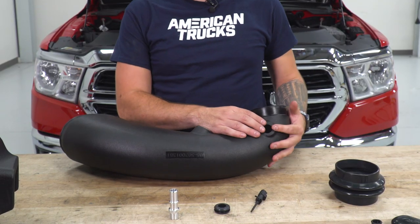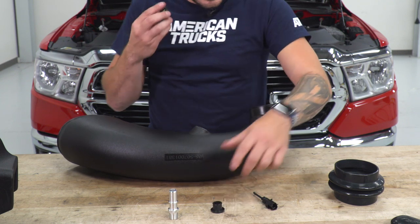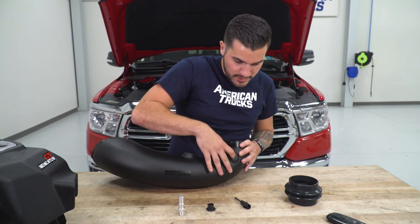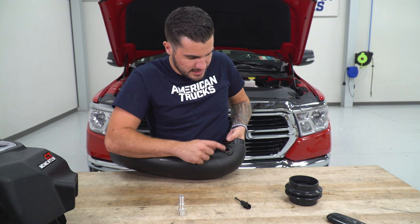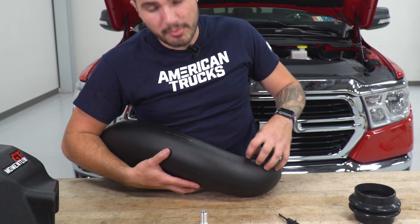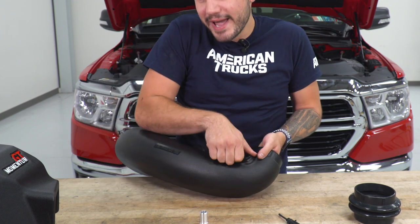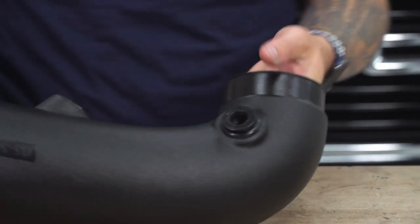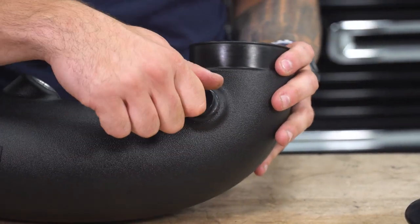Let's focus on the tubing. On the side, you'll see a pre-drilled hole where your sensor will seat. You'll need the adapter and grommet included in the kit — the grommet ensures no air leaks, so set it all the way around that hole, then push the adapter into place. Keep your fingers on the inside to keep the grommet from falling through — you want it to stay seating flush. If it falls through at all, there's gonna be an air leak which may even cause a check engine light. Try again making sure the grommet stays flush. From there, grab your sensor, line it up, and twist it clockwise to lock it.